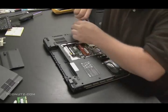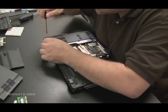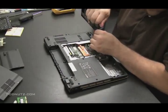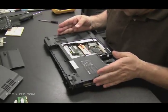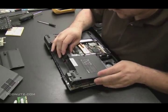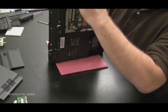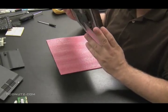If you're a beginner and you're not sure where all the screws go, use the video that was shown earlier about the best way to get screws out of a laptop. Different people have different systems for doing that. Make sure you get all the screws out and then try to take the two covers apart. If it comes apart easy, you know you got all the screws. If there seems like a part that's jammed a little, make sure you have all the screws. And if you're sure you have all the screws, look for maybe a plastic hinge or something that's holding those two plates together.